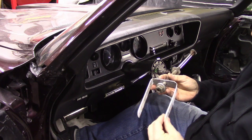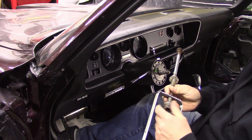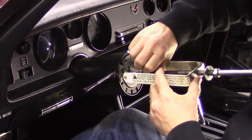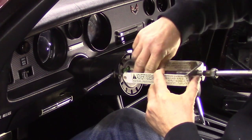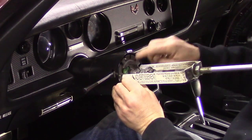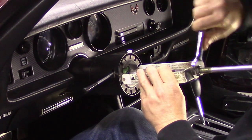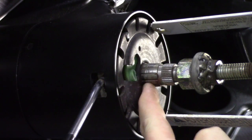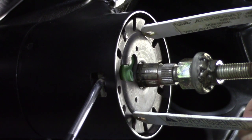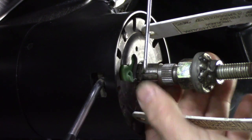This tool will work on a lot of different cars. I welded the nut to another nut — rather than directly to the shaft — so I could interchange it if there are different shaft thread patterns. This nut threads onto the shaft just a few threads, enough of a grip without stripping anything. We tighten the nut down, the two legs support the plate, and if you watch right in here you'll see the locking ring start to be exposed.